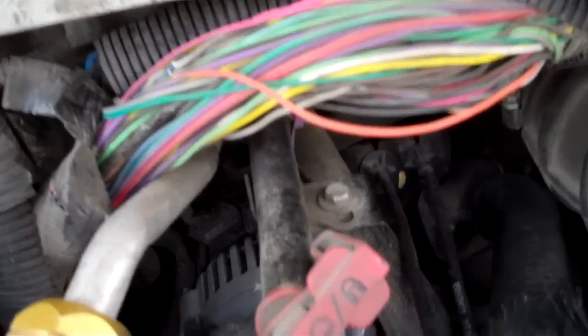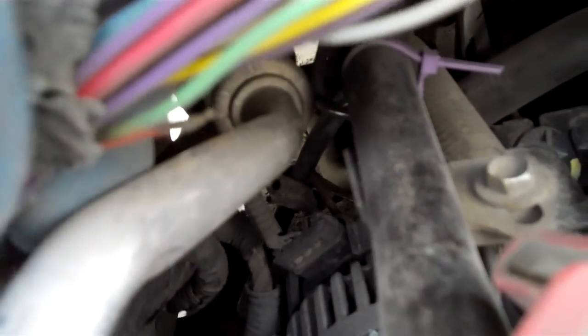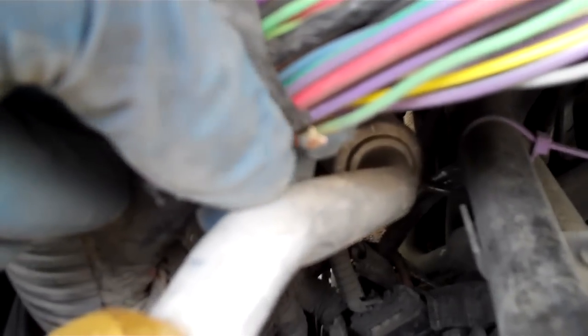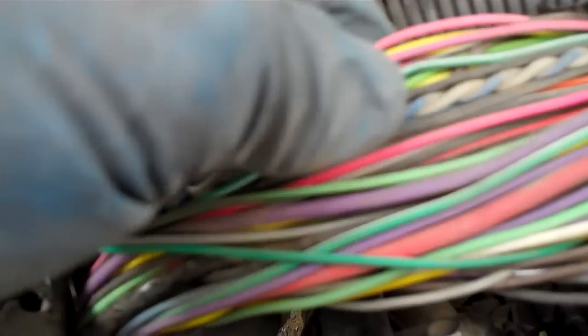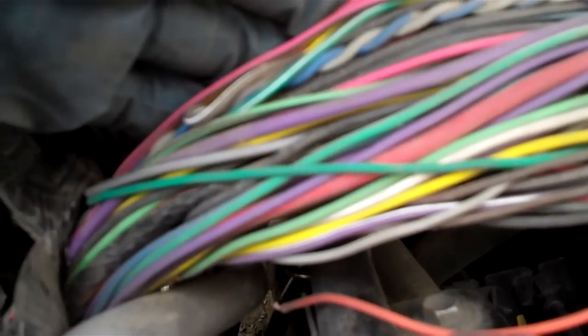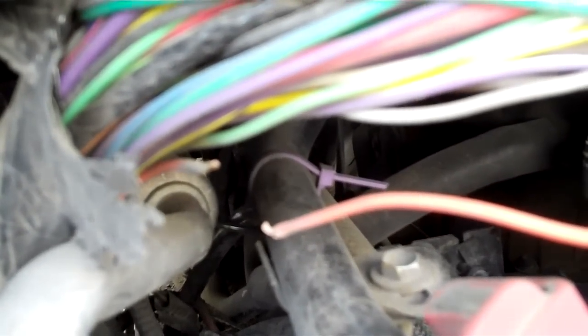As I've opened this up a little bit bigger you can see the rest of that wire — see down at the bottom of the frame, it looks like it just really chafed in there over a period of time. The runner-up for getting hacked was this green wire here, but it didn't affect any of the other wires — I've inspected it pretty thoroughly. What I like to do with a big fat harness like this is make sure you strip back the shielding far enough. I'll go through and pick out a couple of wires, then a couple more, going through it little by little so each wire gets an individualized inspection. You can have all kinds of things hiding underneath and behind other wires when they're all in a bundle. You just have to get manual and tedious with it — but anyway, we found our broken wire and I'm going to correct that.